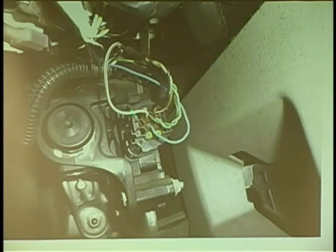Why are we using a diagram? But that's pretty cool that you use your visual. I know it's 6 wires. I know 2 wires have to have 5 volts, 2 wires have to be ground, and 2 wires have to have change. So you put your meter on there and just check for changes. You move it. That's how you test it. You don't just condemn it right away, saying, oh, I have a hesitation. Well, just check it. Once you understand how potentiometers work, it's not really hard to check.